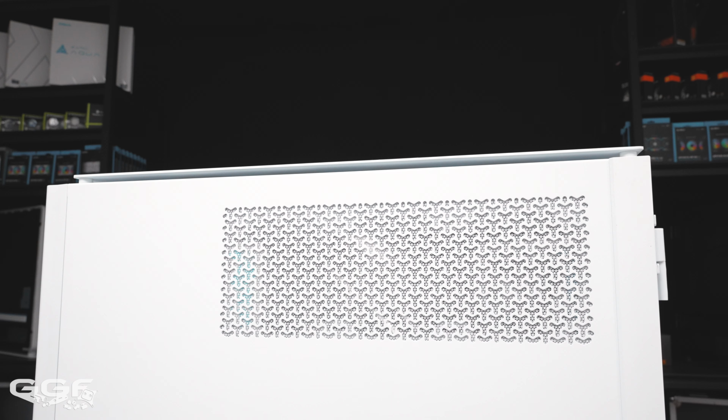If going with a secondary ITX system, one thing to note is this will most likely need to be custom looped. Due to the layout and available size, there is only room for a 2-slot GPU, so don't expect anything too high-end down here unless it's water-blocked. Power and reset buttons for the secondary system are still in the same spot, which is up the back at the top. Corsair now include an external port cutout for future supported link devices.